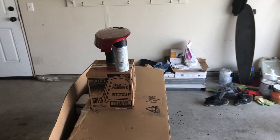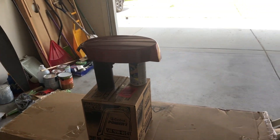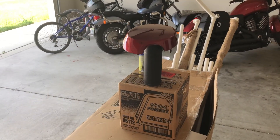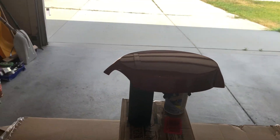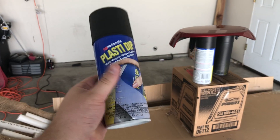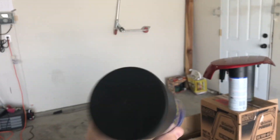Alright, we got them all cleaned up and we got them just kind of floating on top of two cans here. We're gonna try and paint it black, see how it looks. One thing with this plasti dip stuff — shake it like crazy. Two full minutes of aggressive shaking before you use it.